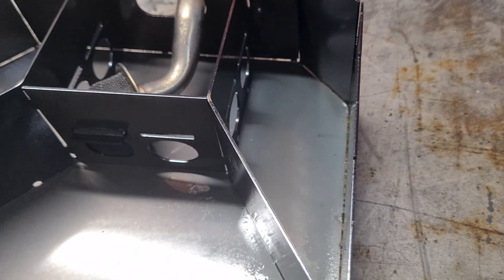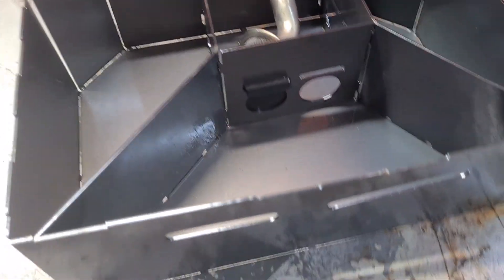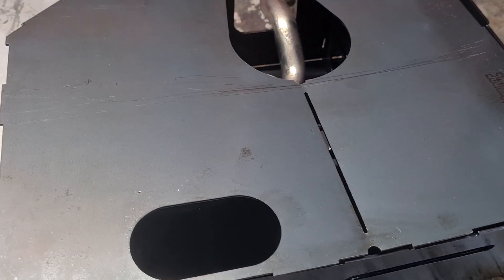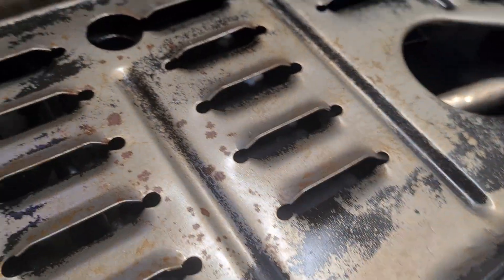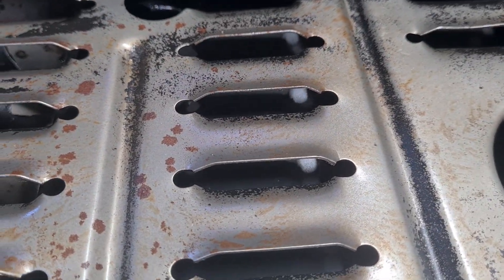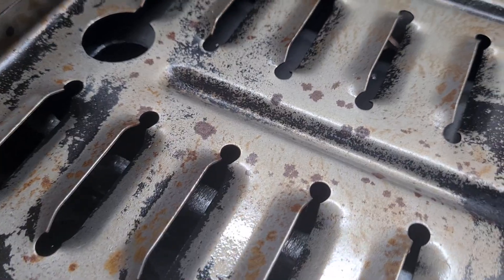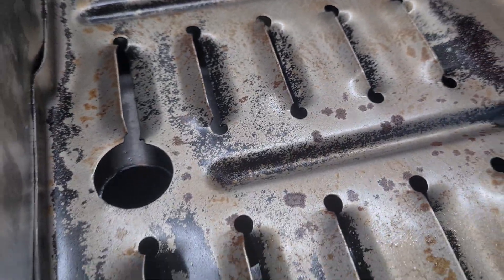It still keeps working, does what it's supposed to do. The top flap helps get all the air bubbles out of the oil before it gets to the pickup tube — just another barrier. You can see where it's welded through the flutes here; that layer just helps keep the air out of the oil, which means the oil pump's not pumping air.